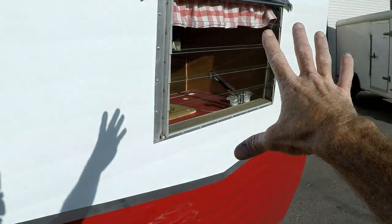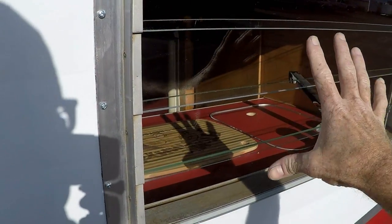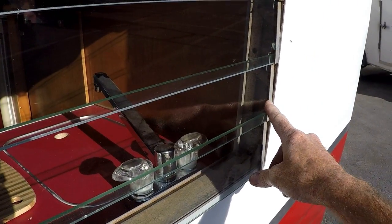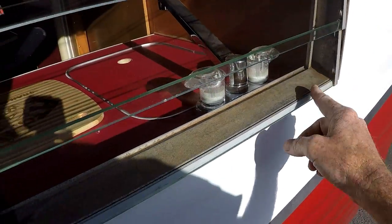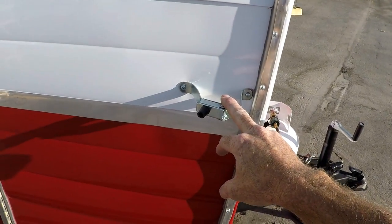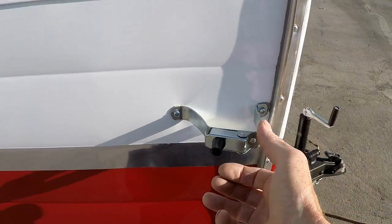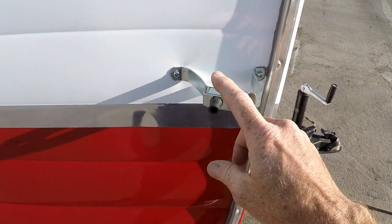These are the original windows - they're Jalousie louvered windows. I did clean them up; this is all the original glass. I just put some new cushions on there to lock them in place and a new seal at the bottom. The entry door hold-back is not original - the original one hooked onto the handle. This one feels more substantial, has a bumper on it, and I always liked this look better.